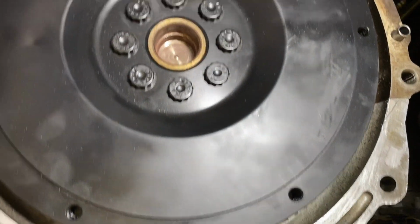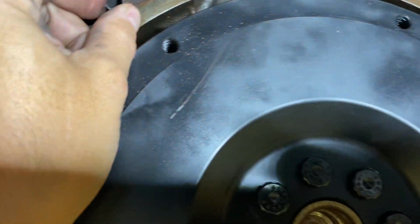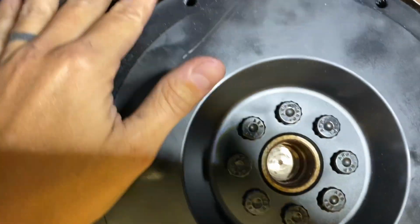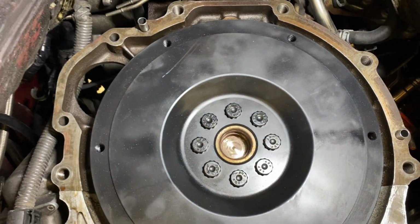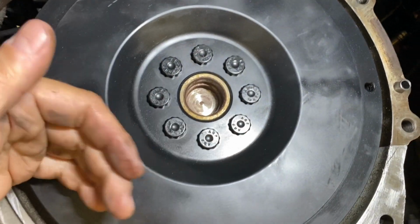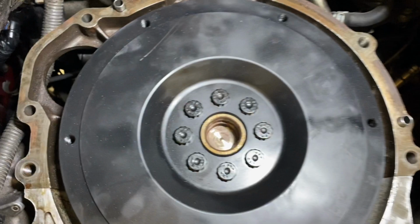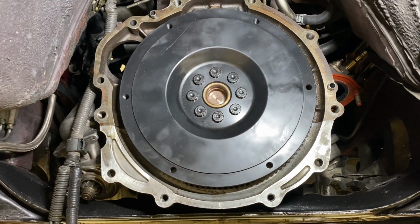So I have both dowels, the one over here and the one up here, pointing in that direction, so they're parallel. The flats on them are parallel with that 2 to 8 o'clock position line, and they're both going to pull the bell down here towards the lower left. So we're going to go ahead, reinstall the bell now on those dowels and see where the numbers shake out.